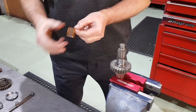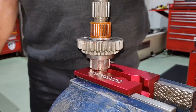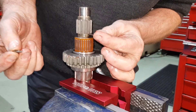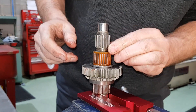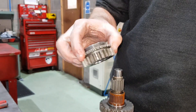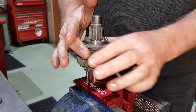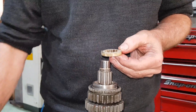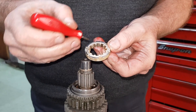To go for third gear, lube the bearing. On this one you've only got one detent and plunger — there's the spring going in, there's the plunger on top. Now third gear: here's your straight-cut third gear Clubman, all cleaned off. Pop it over the top, locate it down, spin it up, make sure it's on the oil. On this one you'll notice there is a recess here which is larger than the other ones — that's where you get the plunger in to push the detent home.